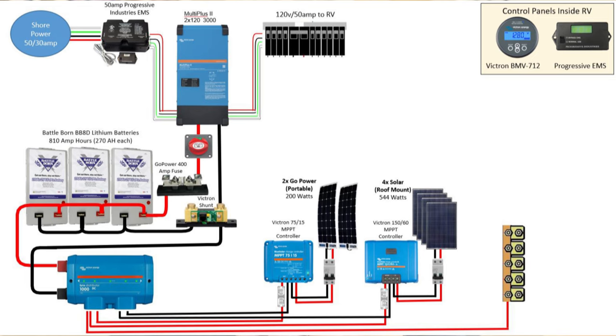What you're going to see next is what I call my rat's nest — where I wire all my systems together, the inverter converter, the batteries, everything. I am planning to make that better in the future. I'm going to pop up a quick PowerPoint to show you: shore power comes in, goes through my Progressive EMS, then I'm thinking of adding a new Victron MultiPlus 2 and powering my batteries through that. I want the Bluetooth capabilities — I love my GoPower IC2000 but it doesn't have Bluetooth. I'll also bring in a Lynx converter for all the positive and negative connections. I don't have any of this purchased yet, just thinking ahead.